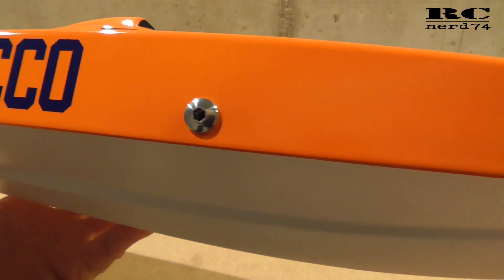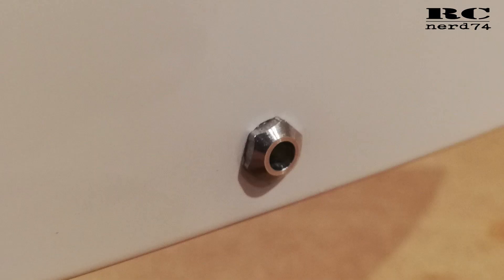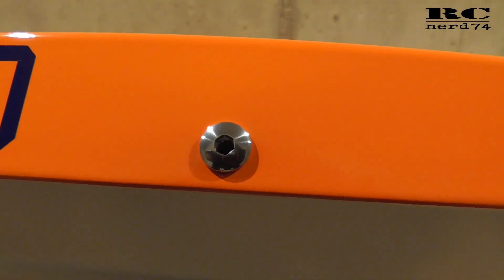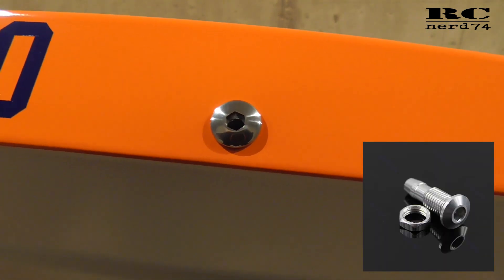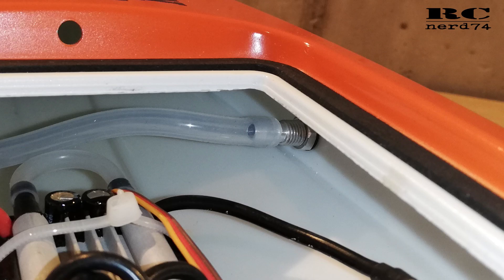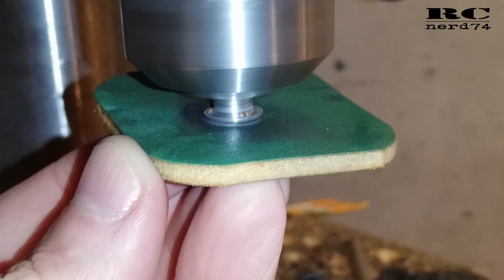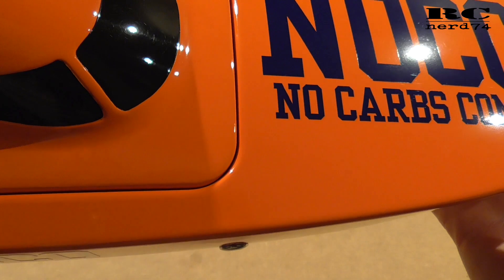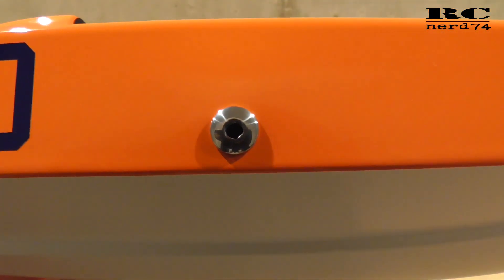This part helps to circulate water and air through the tank. The original part was pretty nasty and bad construction and it also had an extremely heavy steel nut on it, so I ordered a new one from AliExpress which is completely aluminum, including the nut, with a seal ring for better sealing against incoming water. I changed the shape of it and polished it so it's a thinner shape now, it looks nicer than the stock part, and I was also able to save some weight.